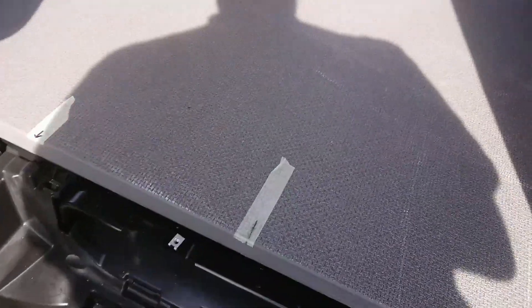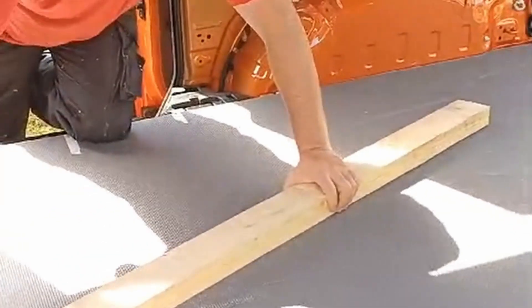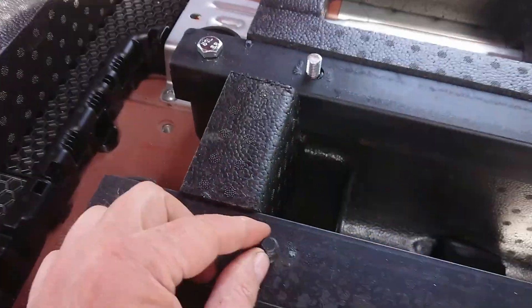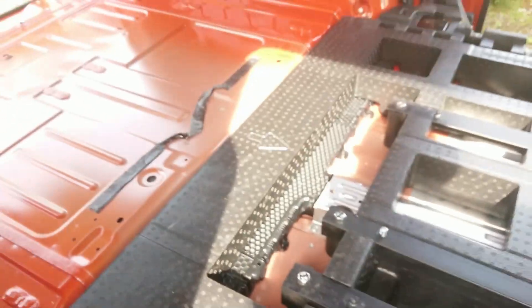The floor's now back in — we've left some bolts protruding, I'll show you shortly. The floor is up nice and tight back to where it used to be, square as best it's going to be, resting very gently on top of some bolts poking upwards. What we're going to do now is give it a smack with a soft hammer, and that should put some indentations on the underside which tells us where to drill through for the seat mounts. The floor's now upside down and you can see we've got those indentations — that's where we're going to be bolting through for the seat legs. We put some studded bar poking up above the bolt heads, gave it a clout with the hammer, and it indented, so we know exactly where to drill.